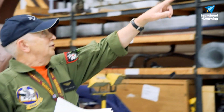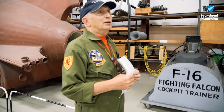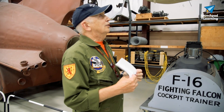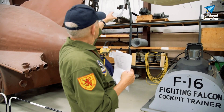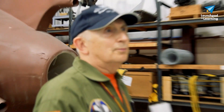Underneath the wing on this side there's a light under the wing — that is the landing light. A lot of people ask how that's going to be of any value when the airplane is trying to land at night, because it would be shining straight down. But when we turn on the switch to turn this light on, it folds out and points forward — just like the headlights on an automobile. This tube sticking out of the wing at the tip there is the pitot tube, which gives us information on airspeed and such in the aircraft.